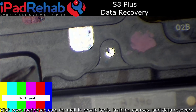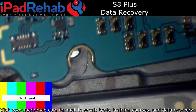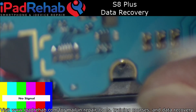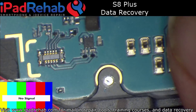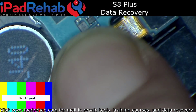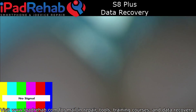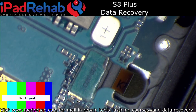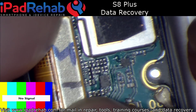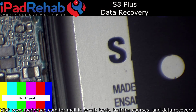I'm going to go ahead and hook up the dock so that if it is booting up I can start pulling data without having to take it back out again. In the S8 and the S7 and every Samsung going forward, it's going to be just like with Apple phones where encryption is enabled by default. From day one these devices are encrypted, and the only way to get access to the data is to have it boot natively.